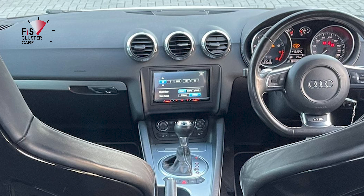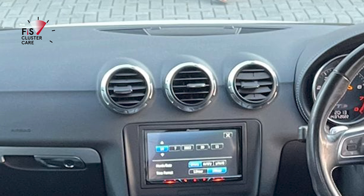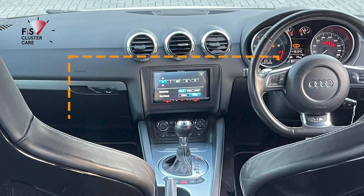Now that's all done, you're ready to go back to your car and remove more parts. First remove the glove box and the three central air vents, then run the three CAN bus pairs from the glove box area over to the instrument cluster area. Connect the harness adapter to the CAN gateway connector and the other side into the CAN gateway — this ensures everything talks to each other for a fully functioning ColorMFA. Since the Audi TT Mark II doesn't have an ignition pin in the cluster, you'll also want to tap into the ignition at the CAN gateway or use a piggyback fuse in the main interior fuse panel.